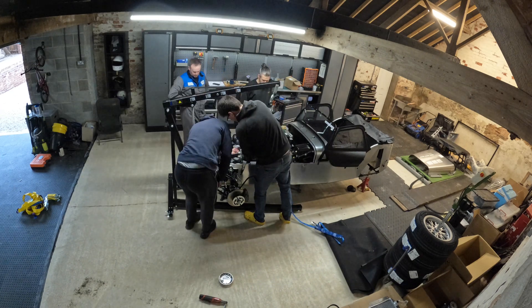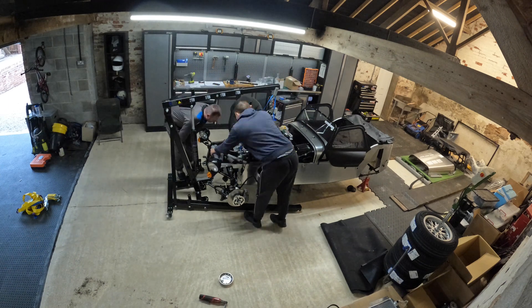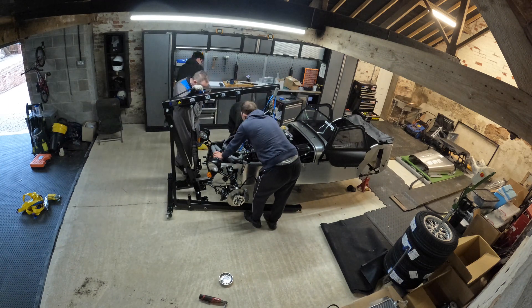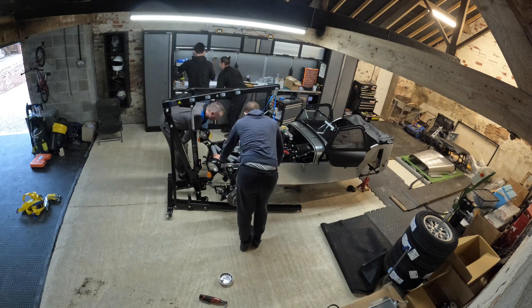So it's really small adjustments. At this point I'm lifting on the inlet manifold to try and give it the rotation we think it needs - we think the exhaust side of the engine needs to go down. Now as you can see, we're threading in a ratchet strap to help with that process, just to tilt the engine, which gets us a lot closer.